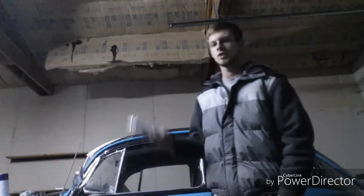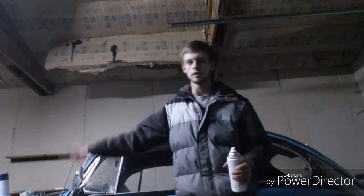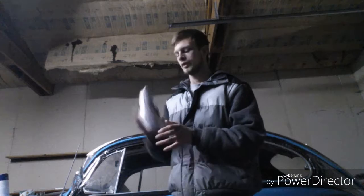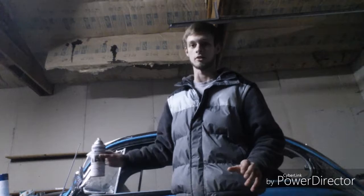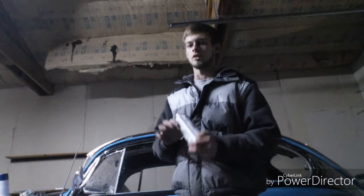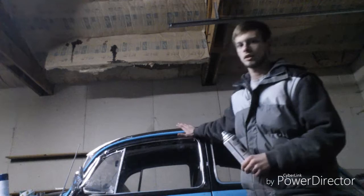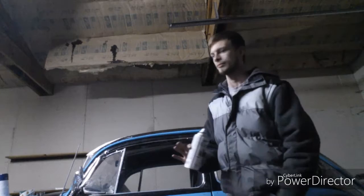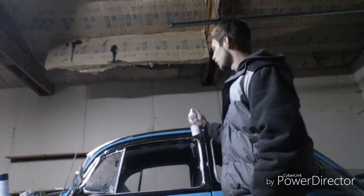I've done a little bit of prep work. I don't want to completely prep this entire side of the car because it's really cold out here, but I have taped off everything that I don't want to get paint on. A couple tips for actually spraying: shake your can. It doesn't take a half hour to shake your can — nobody's waiting on you but you. It'll definitely make your paint job a lot better and it's definitely worth your time. Prep work is everything. If you don't do the prep work, you will not have a good paint job.